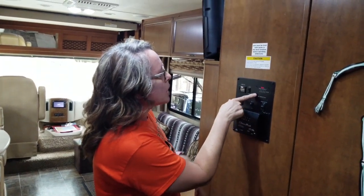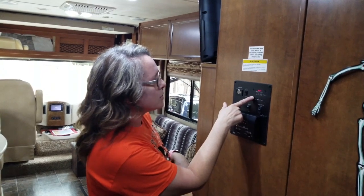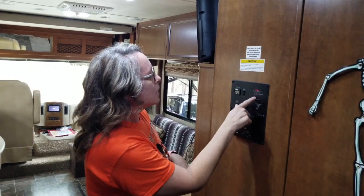I look at my panel. If I need the hot water heater on I'll flip that on, but most of the time I leave it off since it uses propane only — just to save on propane. We don't need the water pump because that's only for when you're not hooked up and filling your tank. The slide's been extended. I do a quick check on propane — we're at a third right now, which should get us through the weekend.